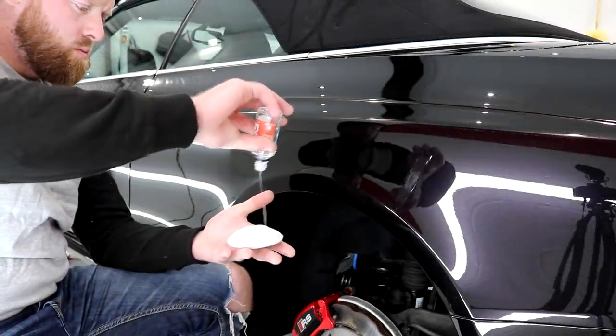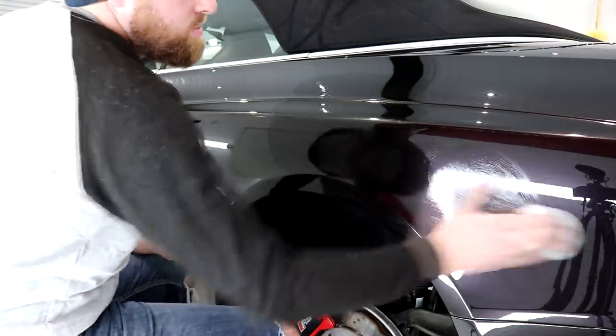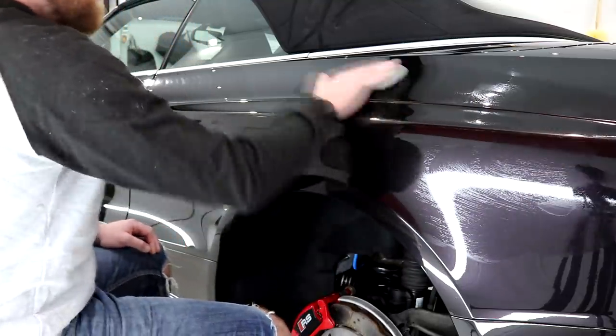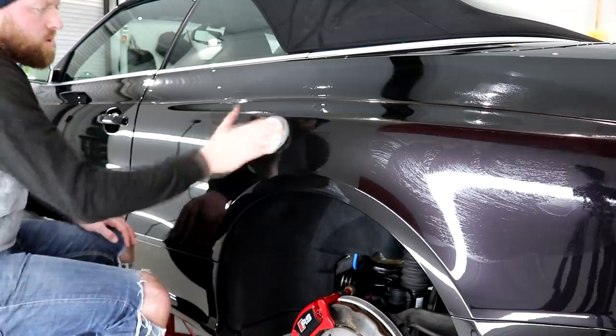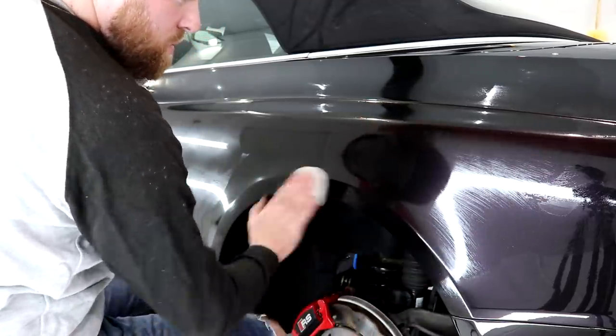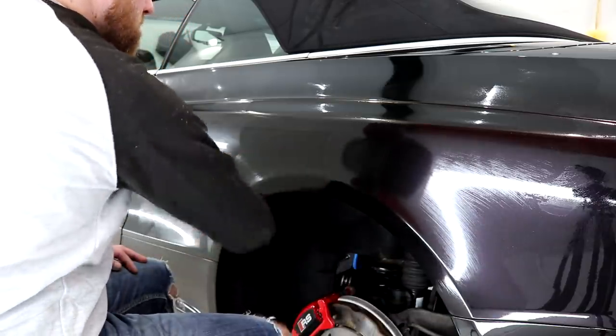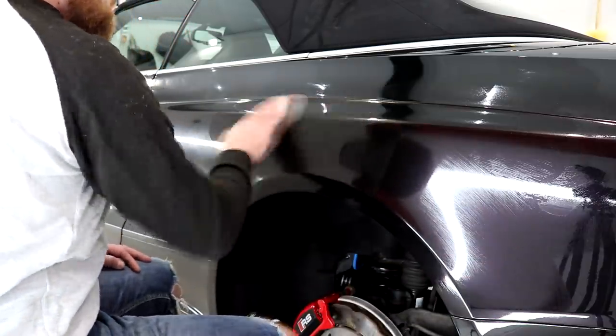Apply to the vehicle, remove with the 2-towel technique, inspection of my results, and when the first layer of XO V4 was finished, I then ceramic coated the second winter wheel whilst the paintwork had its minimum of 3 hours curing time. This was carried on until all 3 coats of ceramic had been applied to the paintwork and all 3 of the winter wheels had been coated.